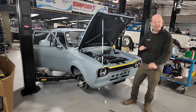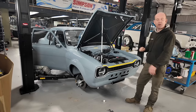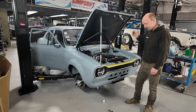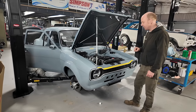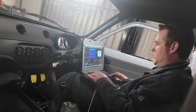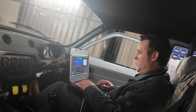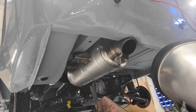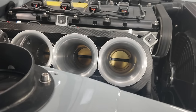Here in the assembly shop, pretty much everybody has been working on the Project One Mark One Escort — we have a deadline we're trying to hit, and as usual when there's a deadline, things start to fight back. Alex has been working primarily on engine calibration, which is at its early stages due to some hiccups — fundamentally various issues with using the Motec ECU to drive the throttle-by-wire motor. There are a few glitches with operating that throttle motor.